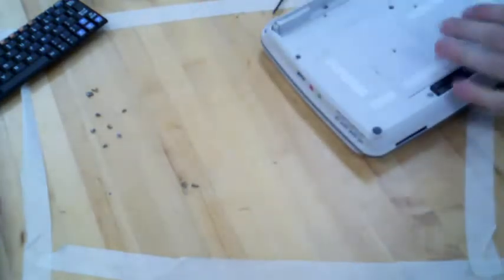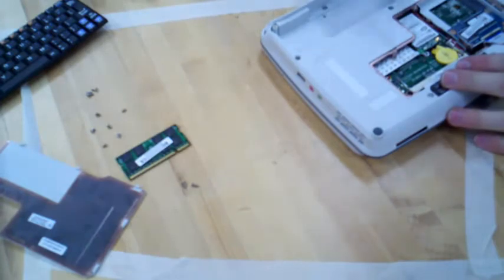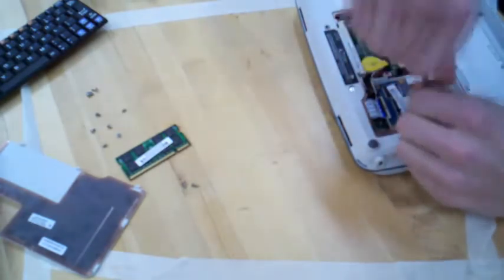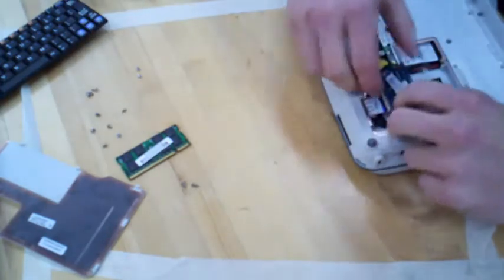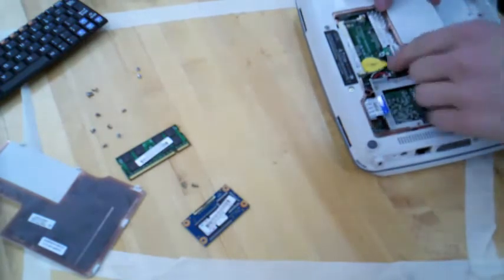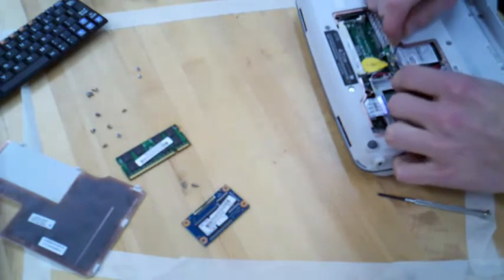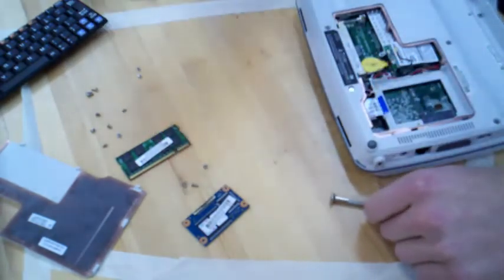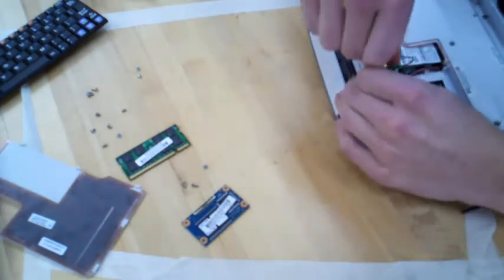On a quick side note, that little black piece of plastic — you want to remove that; it'll save you some time later. Now I just took out the RAM. There are two screws holding in the solid-state drive, taking down two corners — pull those out and you have this clip. You're going to want to flip the black part of the clip up away from the ribbon cable and then you can slide it right out. That's the wireless antenna cable going into the wireless chip, and you just have to pull it off — pop it off with two screwdrivers or needle nose. It's on there a little bit tight.